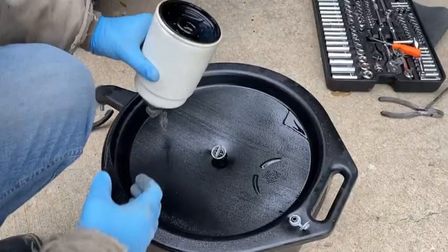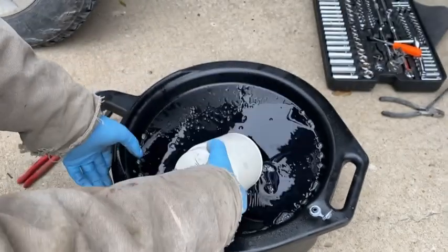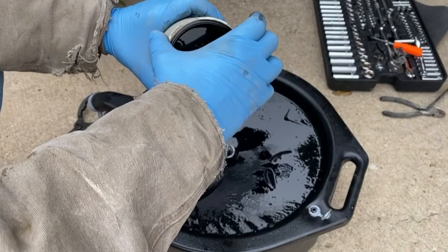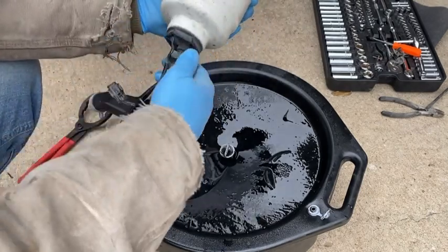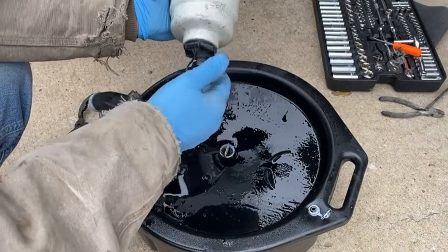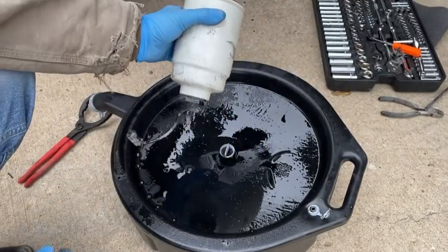So there's our fuel filter. A couple of things to note here. Once again, this is going to be full of diesel. You have to take this water separator off in order to put it on your new filter. You want to make sure that the O-ring in here isn't stuck up on there anywhere — that doesn't happen very often, it's a pretty rare thing, but you always want to check. If you wanted to, in theory, you can stick a hose on this and open that valve to drain your filter before. There's an O-ring on the water separator. Your new fuel filter will come with this O-ring and a new O-ring for that, so make sure you replace those.